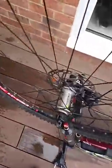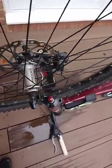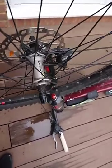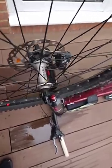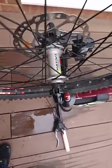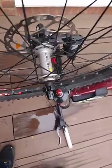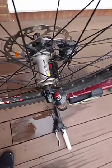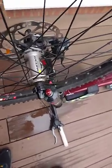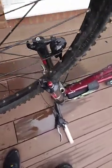Just wanted to check the original wheel back in place — yeah, that's fairly loose when it gets in there. I'm not looking for loads of play but obviously this needs to sit right on the bottom of there quite easily. Where I've got mine at the moment it's quite a tight fit, needs a bit of a push, so I'm going to take another millimetre or so off each side.